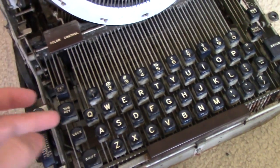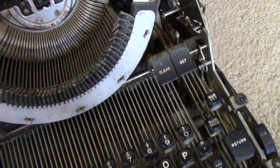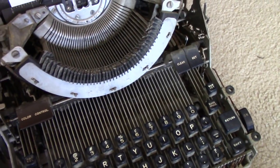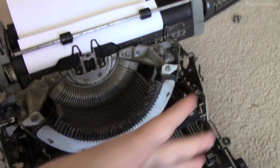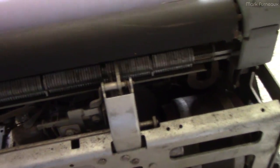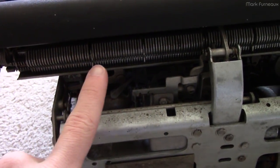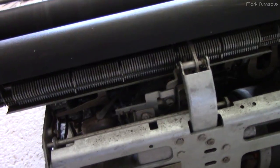The shift works, the shift lock I can fix. The tab does work - the carriage moves with tabs, and tab clear and set also work. The way tab setting works is pretty awesome. This machine has no memory, so how does it remember where the tabs are? A tab is wherever you set it - you can have no tabs or many tabs. It uses little metal pins as memory. On the back of the carriage you'll see all these little metal tabs - these are effectively the memory for the tab feature.